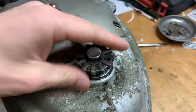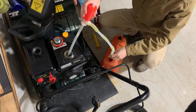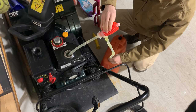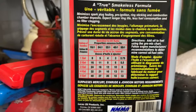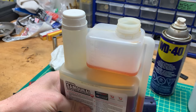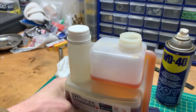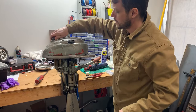Drying that up — there's the primer and there's your adjustment. Let's see what we're working with. I'm gonna need to find some gas, see if I can rob some. Don't need much — just want to see if I can get this thing started. The ratio we're shooting for is 16 to 1 — on a half liter of gas I need about 30 milliliters of oil to get my 16 to 1. Well, that's closer to 40 but whatever. Let's give it a couple pulls and see what happens.